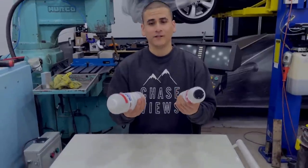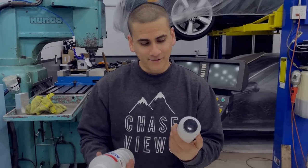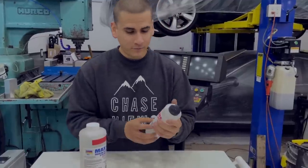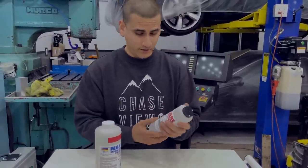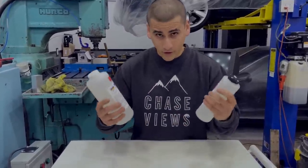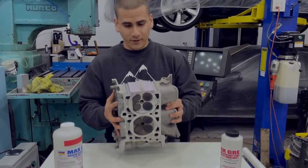What we're going to be using for this is this two-part epoxy - Max Gasoline Resistant Epoxy by the Epoxy Experts. We got this from Amazon specifically because it's oil and gas resistant and it's also a high temperature epoxy. It takes about three to five days to fully cure. But before we use this on our actual heads, we're actually going to be using a practice piece first.